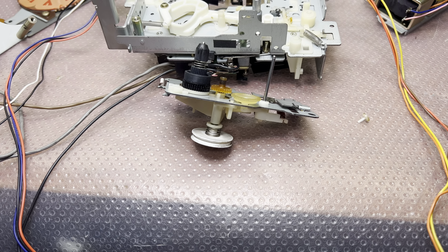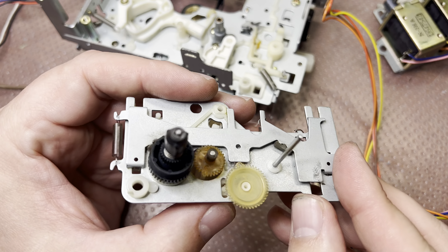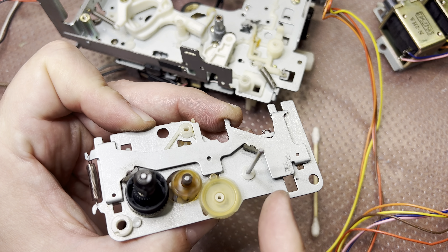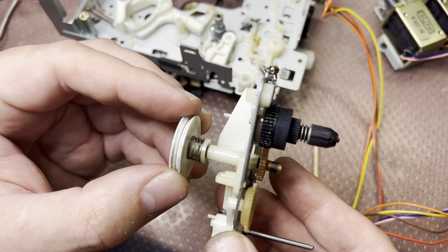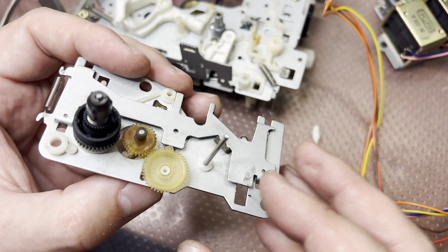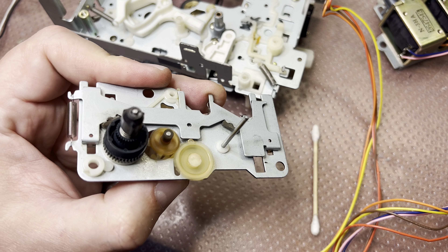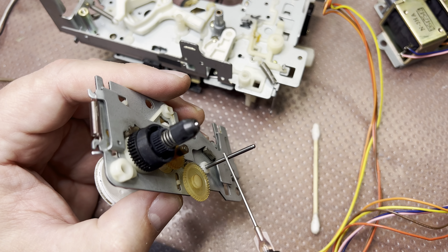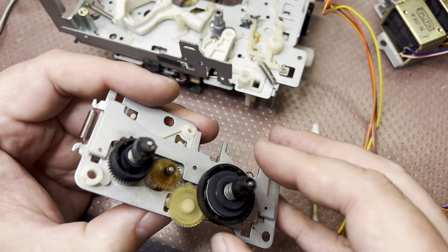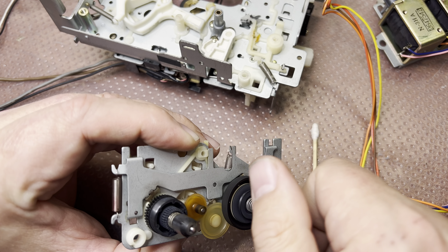That's what I'll try to fix and see if it helps. When it engages fast forward it should rotate like that. I also had to lubricate the shaft for this reel, and this pulley now works smoothly. Together with this gear it should rotate like that. Now let's install the retaining pin — nothing changes. With a little bit of lubricant installed, the reel now rotates freely, whereas before it required significant force.